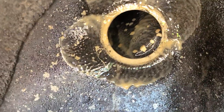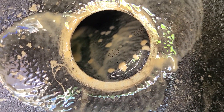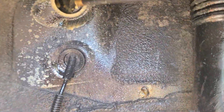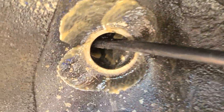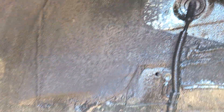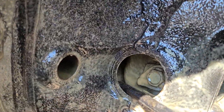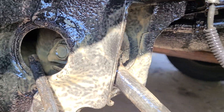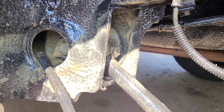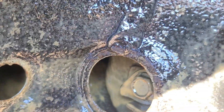Let me show you what I'm talking about. When you go inside the cavities, you want to make sure you have a wand. You see how I'm going in here with this gun and we're spraying it, getting it way inside the cavities. We're coming down here, getting it inside the suspension parts. Can you see that right in there? Now, if you ever got to pull this control arm off, you'll be able to get it — it won't be all rusted out. The salt cannot go ahead and attack that metal or the nut or the hardware because we have it thoroughly coated.